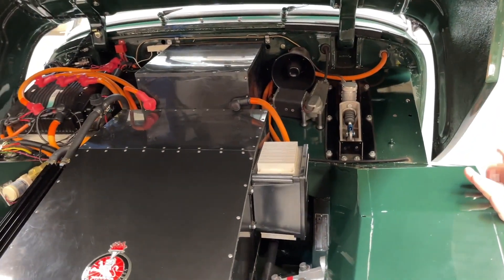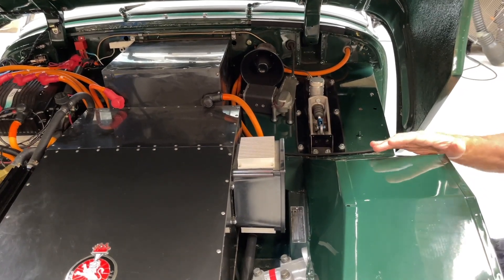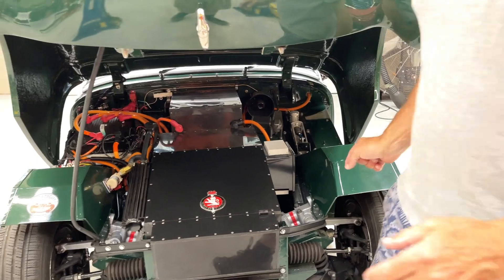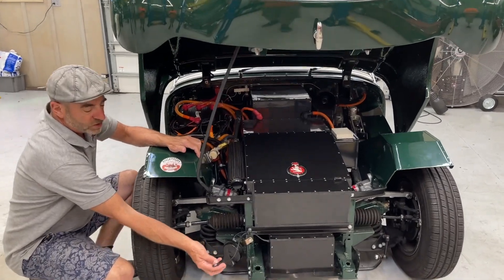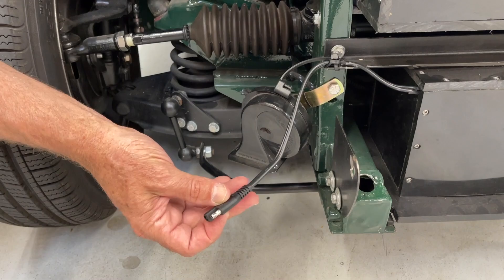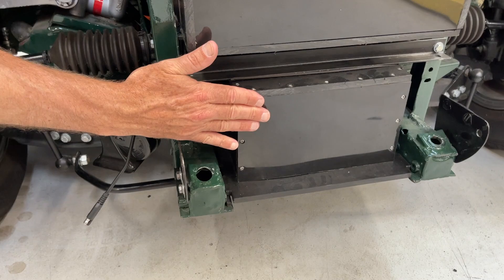If you don't see a leak at the wheel cylinders in the back, there's very little reason for this to leak. If it was leaking you'd feel it on your toes or the floor mat would get slippery. And then we have a trickle charger inside the car that plugs into this lead, and that lead will allow you to sustain a minimum of 12 to 13 volts in here.